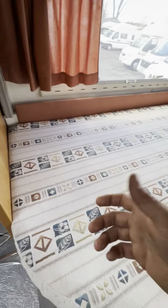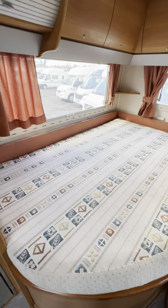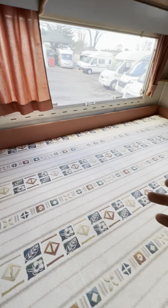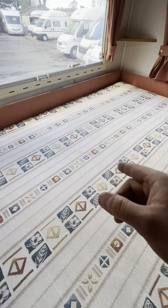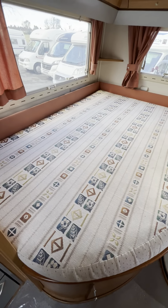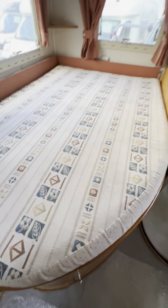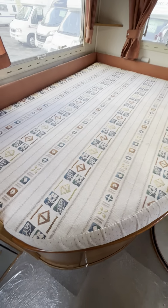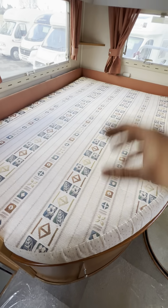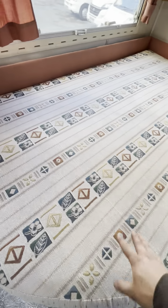obviously, like I said to you outside, you've got the red button out there, which needs to be in the upright position. That's what I was just going to quickly explain. The red button down there, it's your boiler drain, but what it actually is, is a temperature controlled dropout valve. So if it gets down to 2 degrees, 3 degrees, that sort of temperature, you'll find that it will just drop, and all the water from the boiler will just drain out.